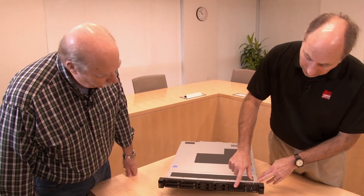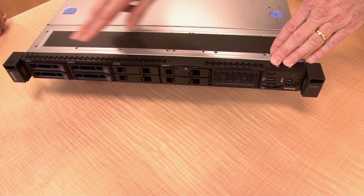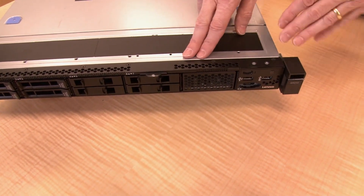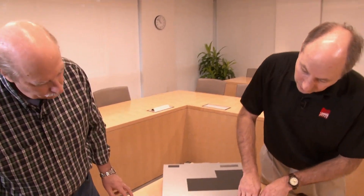Two of the ten drive bays can actually be NVMe drives. These two can be what we call any bay, meaning the backplane is a full ten-drive backplane with ten drive bays for SAS or SATA, but in two of them you could have NVMe instead. NVMe drives are obviously a lot more performant than SAS and SATA drives since they're connected to the PCI bus rather than through a SAS or SATA controller — so lower latency, high IOPS, bandwidth, and so on.